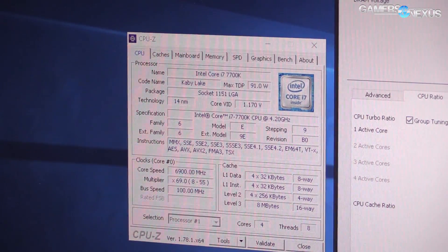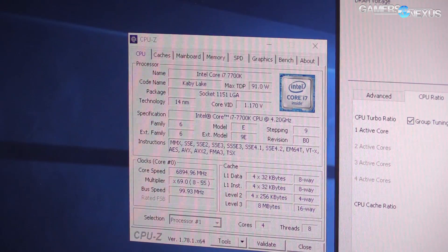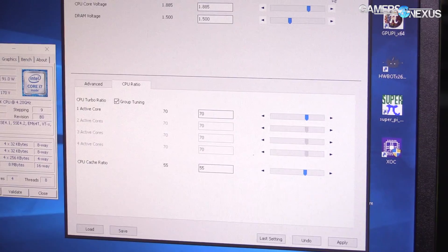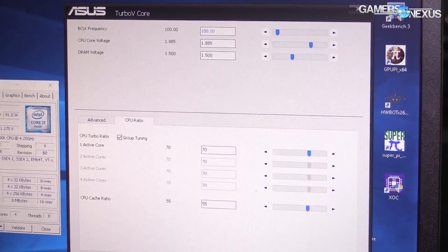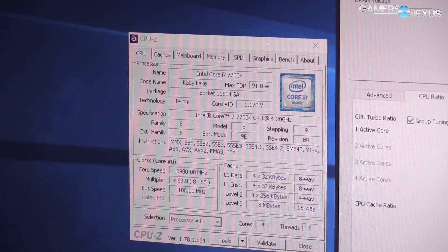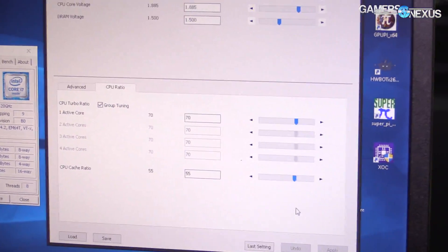Keep going up and let's see how high we can go. We're going to try 69 first — go down one tick. We're at 6.9 GHz in CPU-Z and it's holding. Now try 70 ratio. So we're going for a 7 GHz clock on the i7-7700K. From this point I know this CPU cannot do 7.1 — the higher you go the more difficult it is to apply a higher ratio. You need special voltages just to apply the ratio itself, so once you hit this region you should focus on BCLK.